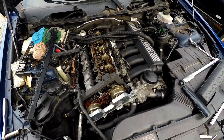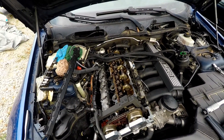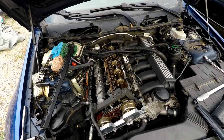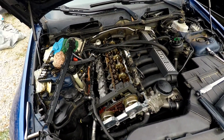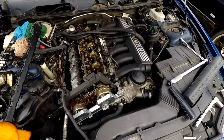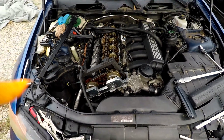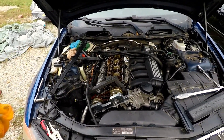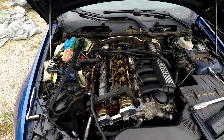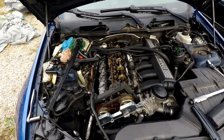I've got to look up the specs on the front bolts and tighten everything down. It sounds like it's about to start raining so I'm trying to hurry — switch that sensor, tighten that bearing cap, and we're 100% ready for the valve cover to be reinstalled. Before we put the valve cover on we'll remove all the timing blocks, remove the pin from the crank, put a 22-millimeter socket with a half-inch drive ratchet on the crankshaft, crank it over probably two times, and make sure nothing's hitting or binding and everything looks right. Fingers crossed the new camshaft and lifters fixed the problem — I think it will.